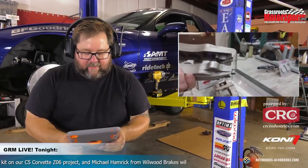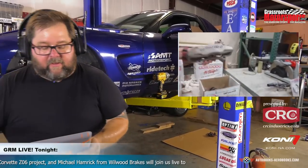There's absolutely nothing wrong with them. And what I've done is checked all of the seals to make sure that they're good. Once I clean them up, I'll go through and check all the seals, and those calipers are nickel plated, so all the seals are in perfect shape. I don't even split the caliper in half. I'll go through and reset all of the bolts that are existing on the caliper, and then rebuild it, and that's it. Okay, awesome.